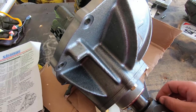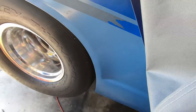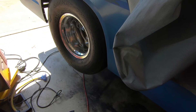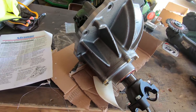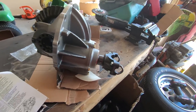The lower that number, the higher mile an hour you can get out of it. So since this is a 3.50, it will have a higher top end than say a 4.50 or a 6.50 — the higher the number, less top speed but you get a lot more gear advantage. We'll go ahead and rip the old one out. To do that, gotta pull both tires, pull the brake calipers off, brake rotor slides out, spin the axles to pull the retaining plate, slide the axles out just enough to pull them from the diff, unbolt the diff, slide it out, slide the new one in, then reverse the process — axles in, retaining plate, brake rotor, calipers, and wheels. Let's get to it.